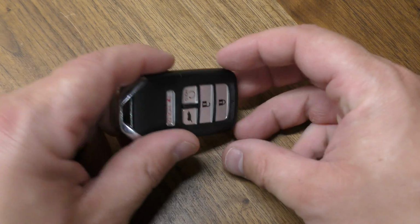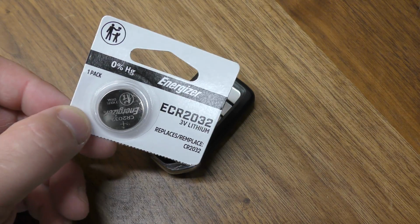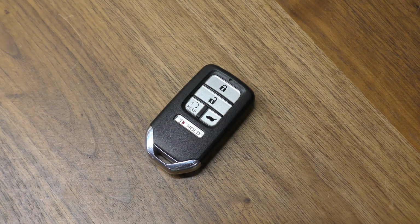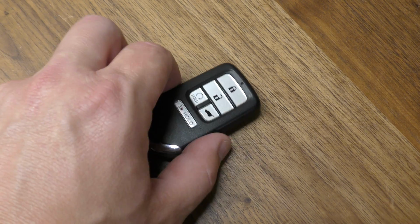Hi there, I'm going to show you how to replace the battery in this key fob. This is out of a CRV. You're going to need a 2032 battery. You can get these off Amazon. I've included a link below in the description. And you could use a flat blade screwdriver, but it's not necessary.